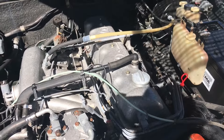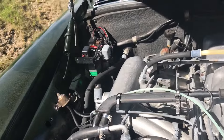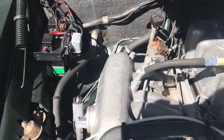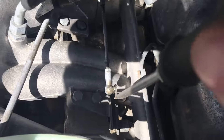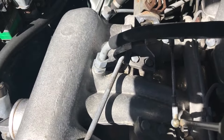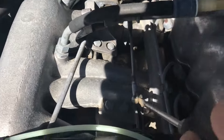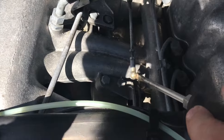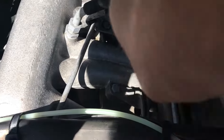On my first test drives after the winter, I found that the accelerator pedal was sticking. So I thought I'd clean this up. We start with popping off the linkage. A little bit hard to get that one off, so I think I'll start on the other end.